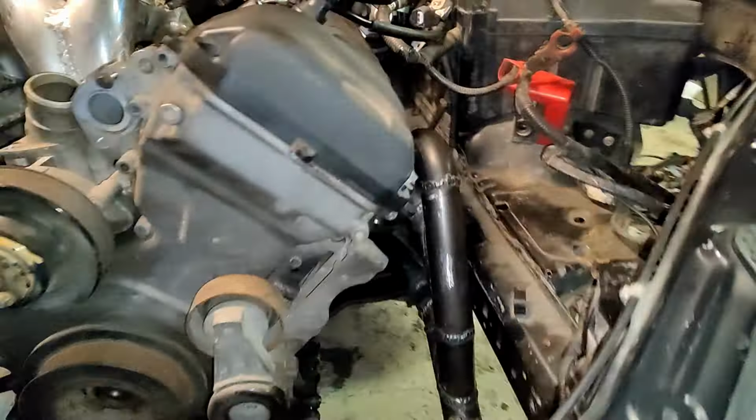And then if we go to the charger side, you can see that I had to modify the XKR charger coolers. There's an adapter for hose now. And I pulled out the other cooler so you can see the setup. So we have now two and a half inch pipes which merge into a 3 inch pipe. Then we have an elbow from the Jaguar XKR 2007 model that has been integrated to the supercharger, original M112 supercharger. And then we have here the original 2007 XKR throttle flap, which is the electronic version.